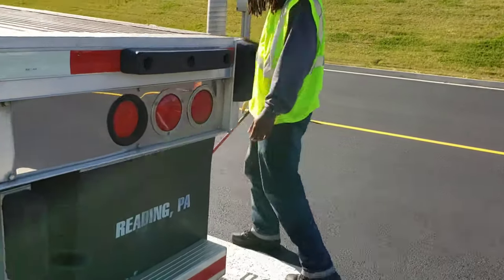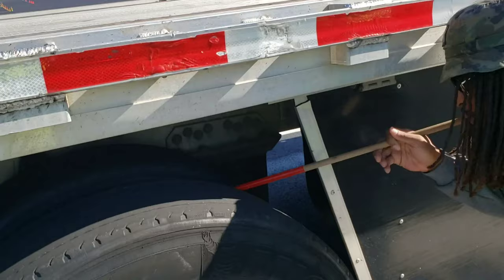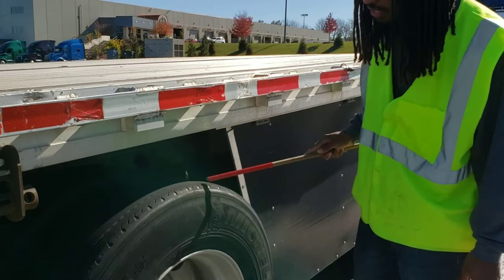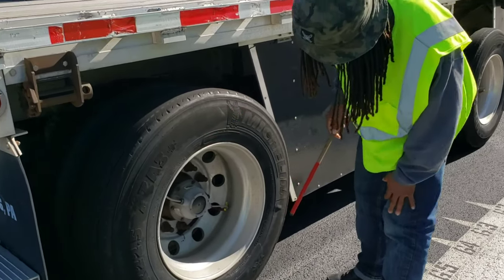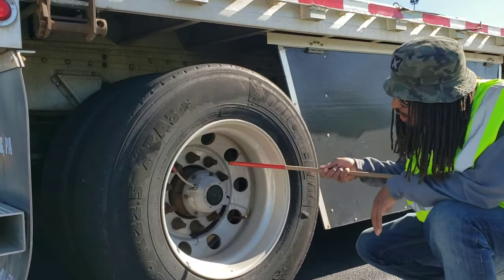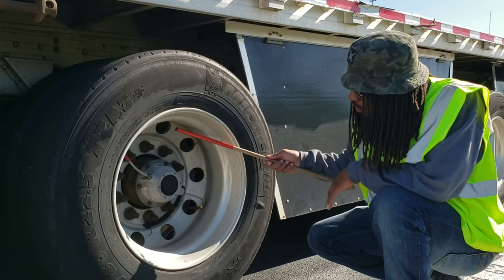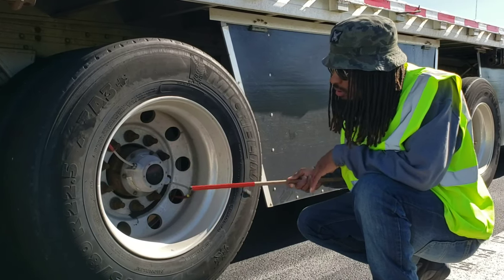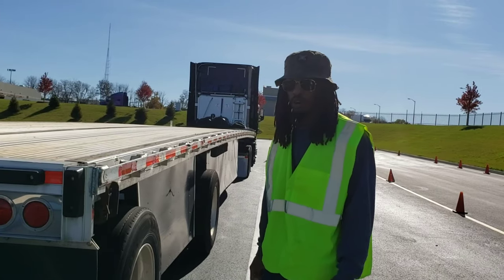Moving on to my tires. I have dual tires on this trailer, so I check that there is proper spacing between the tires and there is nothing stuck in that spacing. My tires are properly mounted and secured — on the tread and sidewalls, no abrasions, bulges, or cuts, and the tread is no less than 2/32nds of an inch. It's filled to manufacturer specifications when checked with an air gauge. My rim is properly mounted and secured, not cracked, bent, or broken, no unauthorized welds or holes. My lug nuts are properly mounted and secured, not cracked, bent, or broken, none are missing, no powder residue or rust trails, and no cracks around the bolt holes. My axle seal is properly mounted and secured, not cracked, bent, or broken, it's not leaking, it's filled to manufacturer specifications, and there are no missing mounting bolts. Last, my mud flap is properly mounted and secured, not cracked, bent, or broken. And that wraps up the trailer part of the pre-trip inspection.